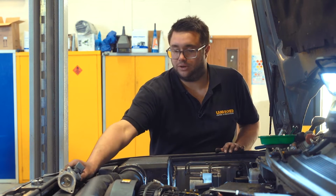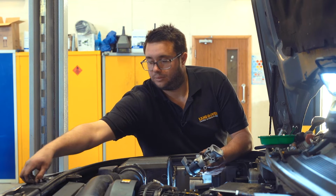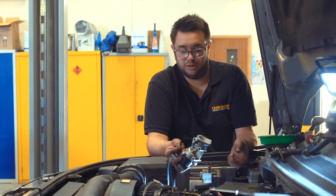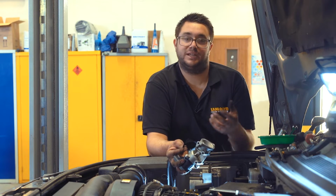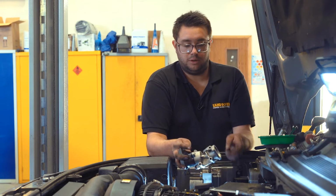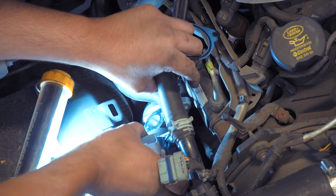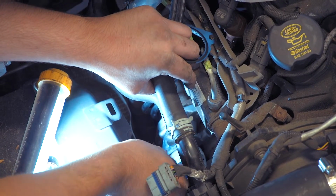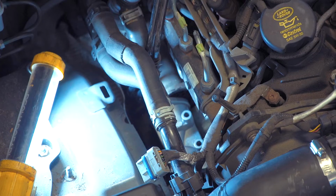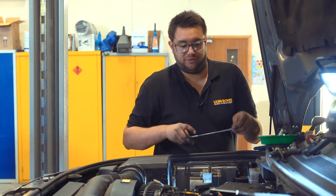So now we can take our new valve and our new gasket. As with the other side, we're going to start the outer screw first, so it makes aligning the gasket a lot easier to then start the other screw. So manoeuvre that into place. That can just sit there until we've got the other screw through the cooler. You can actually use the magnet again to get the screw into place without fear of dropping it.